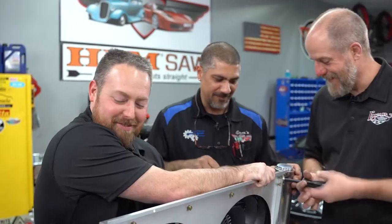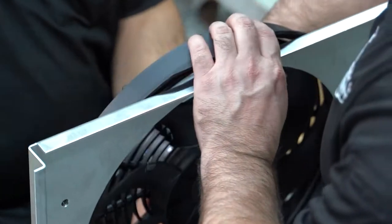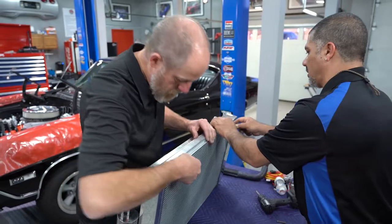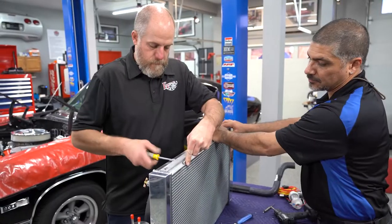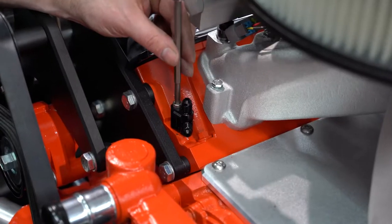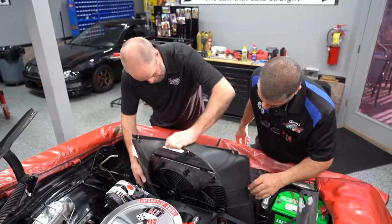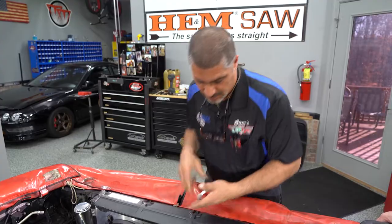That is one nice reservoir. The way Kevin mounted it onto the shroud makes it one big module. When you install the fan shroud onto the radiator core, you're going to have to drill into the bottom and top sides of the core itself — this is a false space, so don't be scared to drill, but make sure the drill is perfectly straight. If you have a slight angle, you're going to go into the core, costing yourself a radiator. Travis made a Dash 4 line using the Holley steam vent kit — a nice braided hose that matches everything else in the engine bay. The reservoir Kevin mounted on the side of the shroud gives us plenty of access, and we'll run it underneath the radiator to keep everything clean.